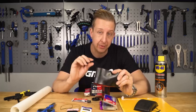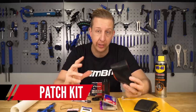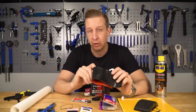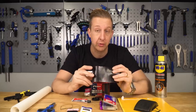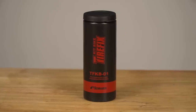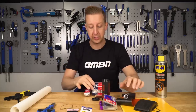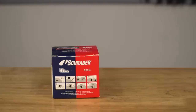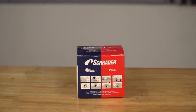You're going to need a decent patch to cover the cut from the inside of the tyre. Not only does this help stop the cut growing, it also ensures you'll be able to set the tyre up tubeless again later. Look for stuff in the motor industry - suitable for ATVs or motorcycle tyres and tubes. This one is made by Schrader: it's heavy duty rubber and works really well with industrial strength vulcanising solution. You can also get purpose-made giant patches for motorcycles, suitable for both tyre carcass and inner tube.